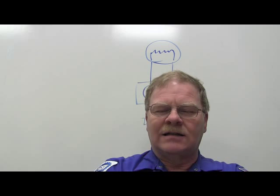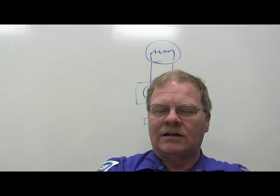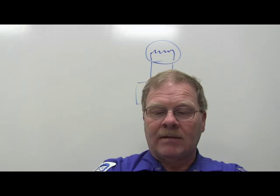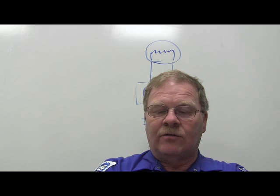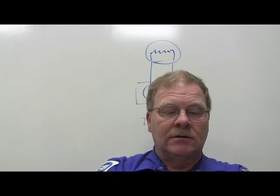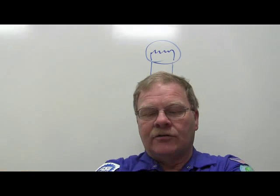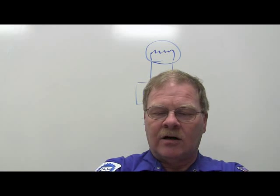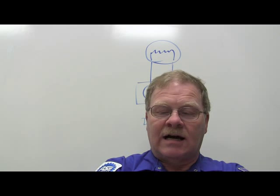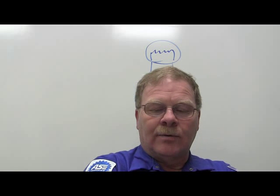Technician A says the stoichiometric ratio for gasoline is about 9 to 1. Bah, humbug. Technician B says the stoichiometric ratio for ethanol is about 9 to 1. Who's correct about that? B is correct about that. Using an ethanol-enhanced or reformulated gasoline can result in reduced fuel economy. What you were asking me a while ago, and the answer is what? Yes, true. Of the alternative fuels listed in the text, which has the highest octane? How about A? Compressed natural gas.